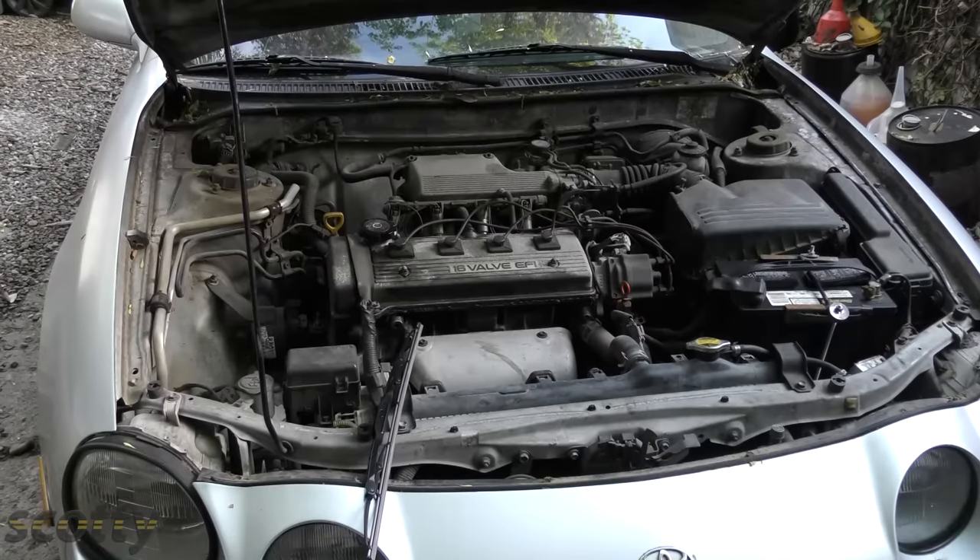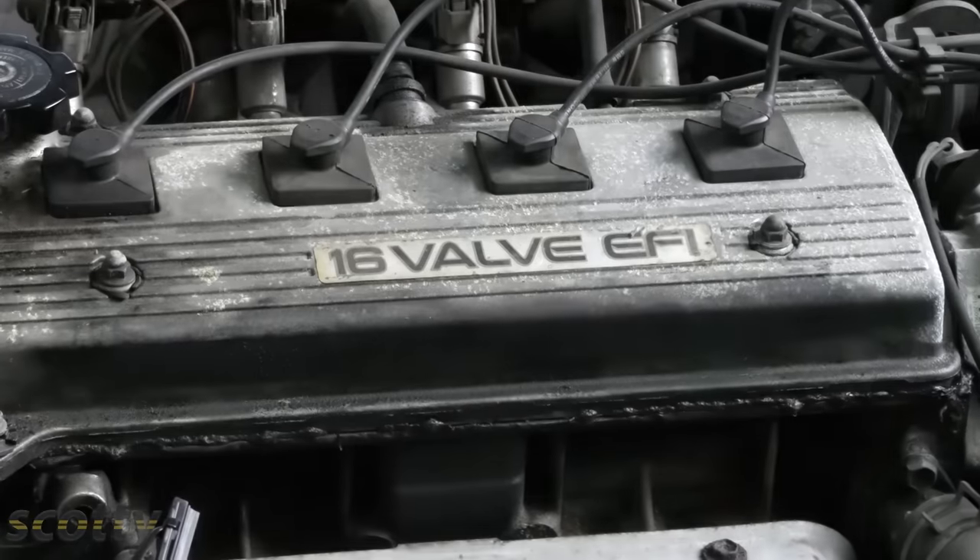Silicone is just a stronger, longer-lasting material. Years ago I put a silicone valve cover gasket on my Toyota, which originally came with a rubber gasket. When I found out the silicone ones are supposed to last longer, I put in the silicone one. I used to have to change the old rubber valve cover gaskets every three, four, five years when they'd start leaking, but the silicone one's been in there for more than ten years and it's still not leaking. So it is a better material.